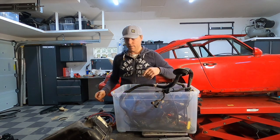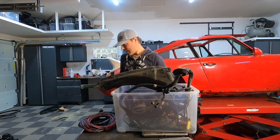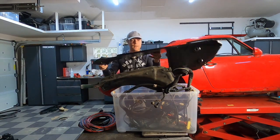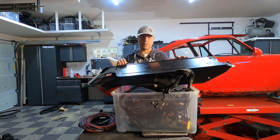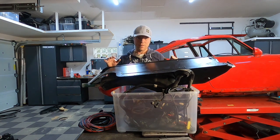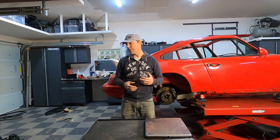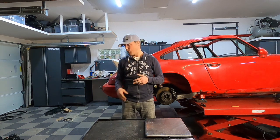We're also removing two of the three horns, the washer fluid tank, and the bracketing where the central electric used to sit — all this sheet metal is heavier than it needs to be. We're at 11 kilos considering what we've added back in. In summary: 35 kilos saved this time around. Five kilos from the ABS, 11 from the hood, another 11 from the bracketing, harnessing, washer fluid tank, and horns, and another 8 from the ventilation. So a little bit more than I thought.